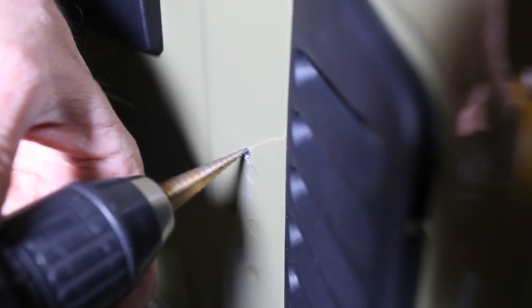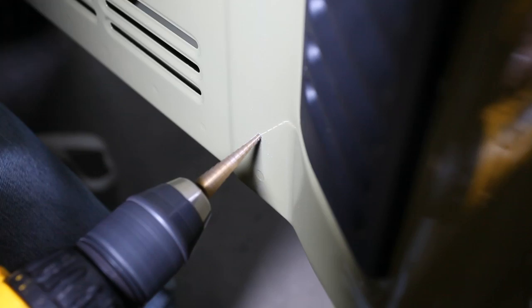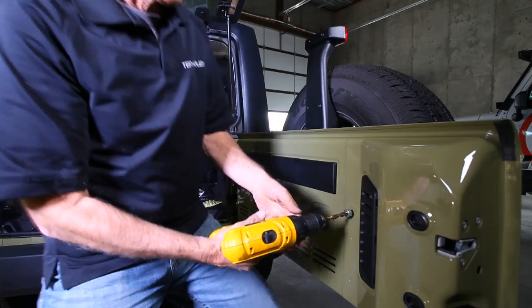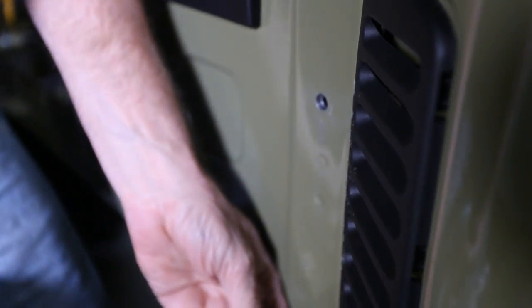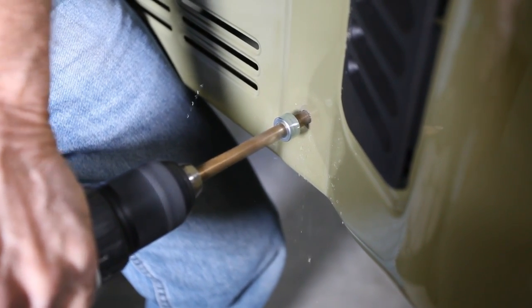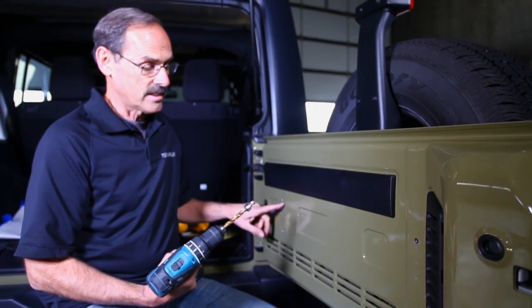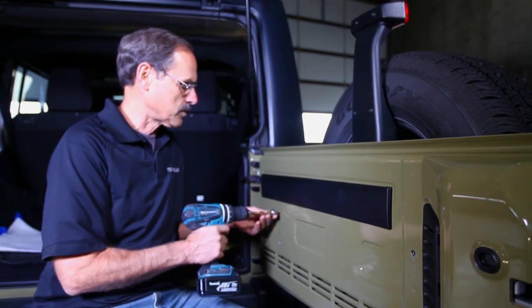You will notice it's going to take a little more effort to drill these holes — it's double plated in here. Just switch out your bit to that 25/64th and final drill them. It's going to go through this side a lot easier, so when you're pushing on it you don't need to get so violent — let the drill do the cutting so you don't warp the hole and you have a nice flush surface to put that nutsert in.